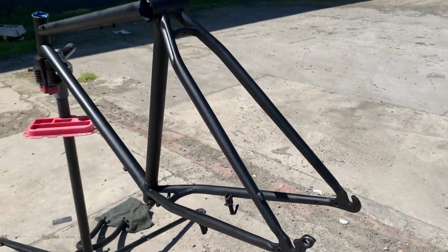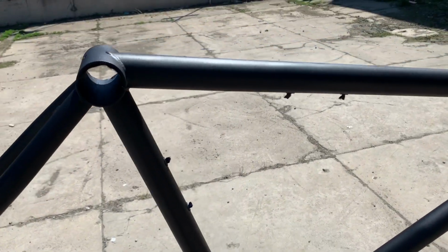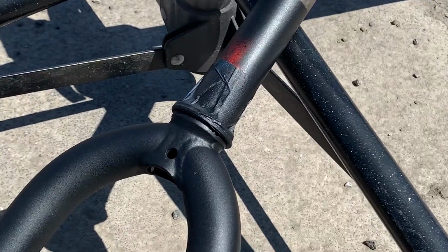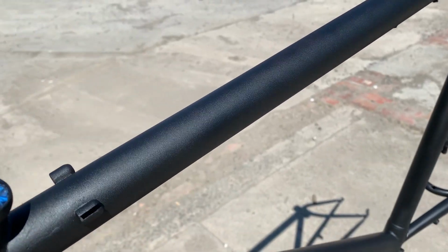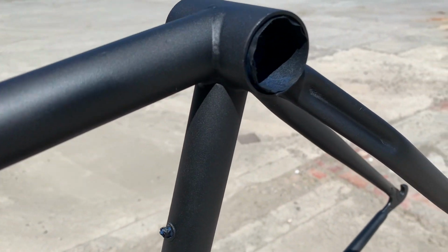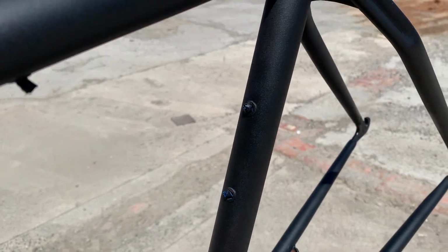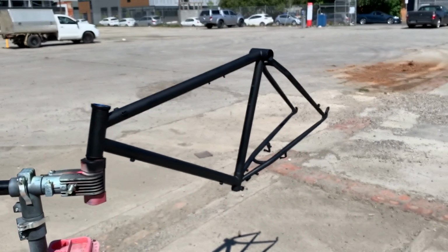Number two is the handling of the paint. Because you have to hold the can a little bit closer to the frame, it's going to spray a little bit different. So I think there are pros and cons to this. The pros, I would say, are some hard to reach areas where previously it was hard to get your hand into, you can do it with the short spray. On the other side of that are the areas where you want that longer spray. The paint is just going to dry a little bit different, just because you're further away from the frame. The texture is going to be slightly different. Some people might not even notice the difference, but I just want to give you my experience with the paint.